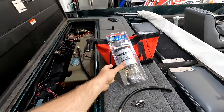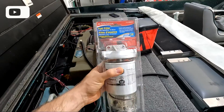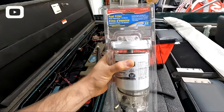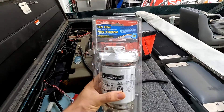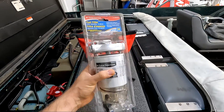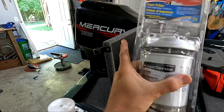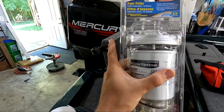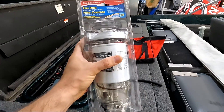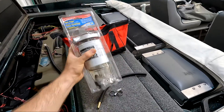For today's video I'm installing an onboard fuel water separator. As the name implies, this gets installed in line from your fuel tank into your engine to separate water out of the fuel. In addition to separating out the water, it also has a 10-micron filter. This will filter out any large particles before they reach your onboard fuel filter under your cowling. The fuel filter on your engine is usually around two to three microns, which is really small. This is a great first defense against larger debris that will help your fuel filter on your outboard last a lot longer.